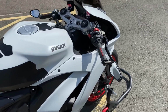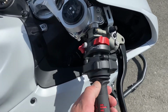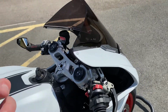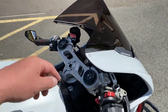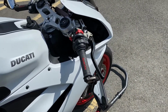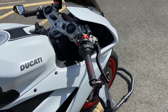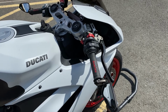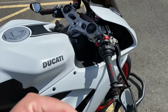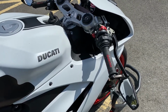So I took the isopropanol spray and sprayed it on the inside of the grip, and just let it run through the grip and drip out the bottom. Both sides were identical, the way I did it. And then I thought, I wonder if that'll act as a lubricant to slide it over the bar. And sure enough, guys, I sprayed the inside of the grip. I didn't spray any on the clip-on itself. All I did was spray it inside the actual new grip, and it just slid on so easy, so easy.